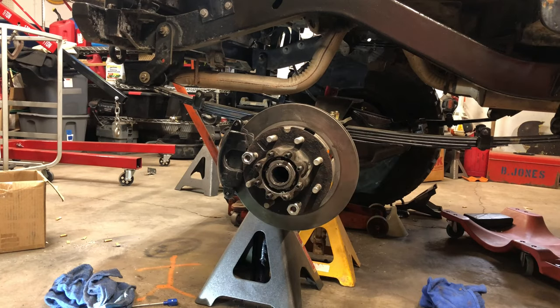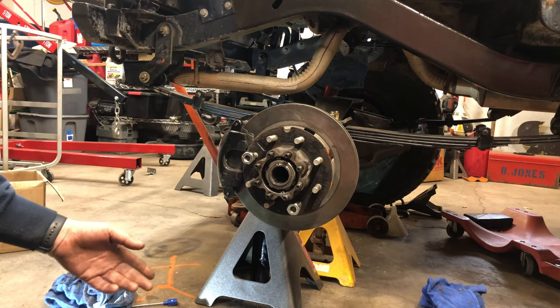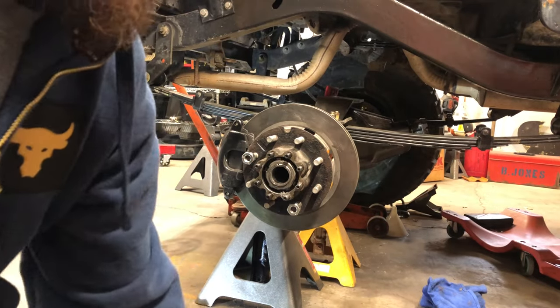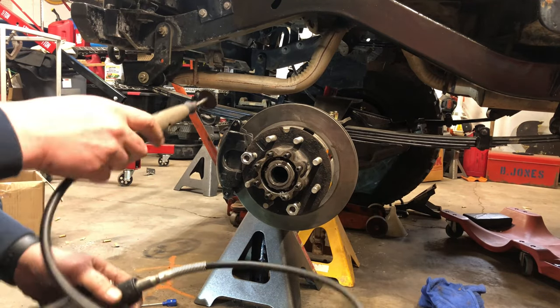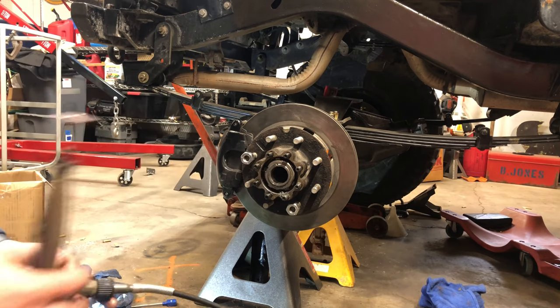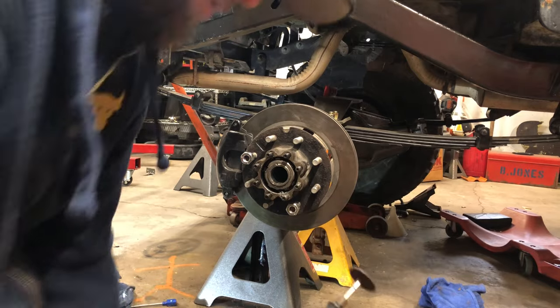Dealing with these pieces in here, originally I was just peeling them out of their pliers, but now I'm so deep in there, I can't get to them. And so I came up with an idea. I don't know if it's gonna work. This is my old 20-year-old Dremel and a little baby cutoff wheel, and I'm hoping I can just get in there and zip that thing off of there so I can continue drilling. We'll see how it works.